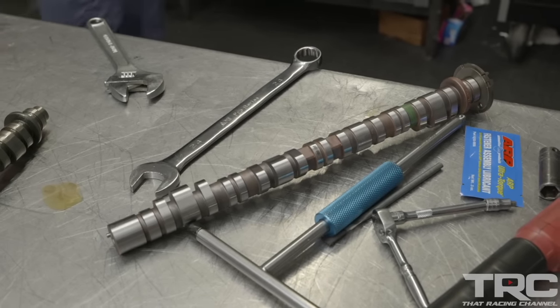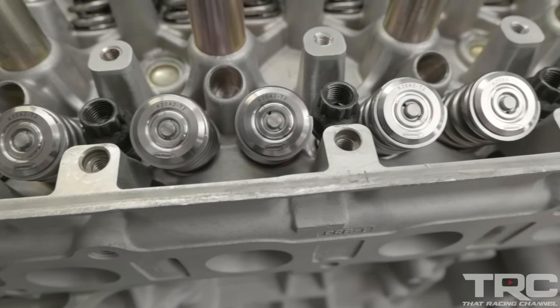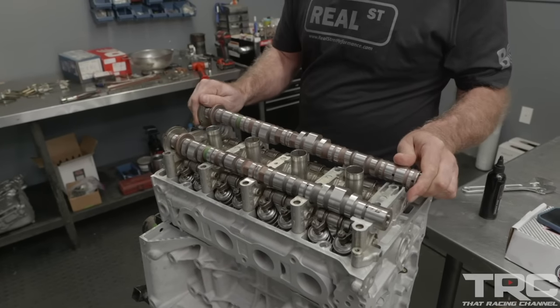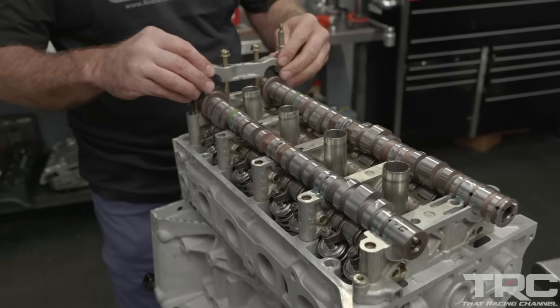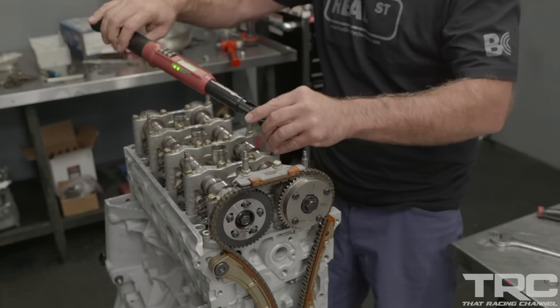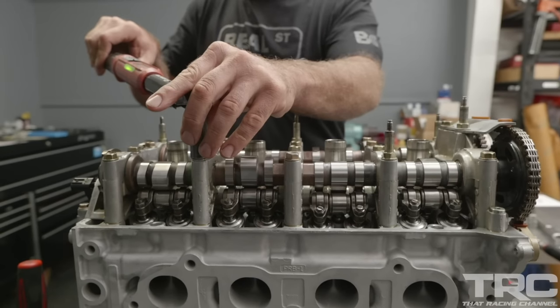The cylinder head consists of Drag Cartel 3.2 cams, SuperTech valves, SuperTech valve springs, and Mazworks did all the machine work on it. Pretty nice built head, nothing crazy, but it does have a lot of camshaft in it. So as long as we can get enough turbine flow, we'll have a pretty high RPM engine. The engine will start off with the same 6466 that's on it now. The way that things go with Javier and his guys, it's likely to end up with a larger turbo as things go.